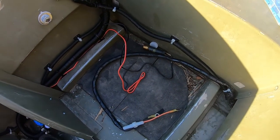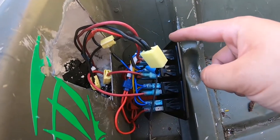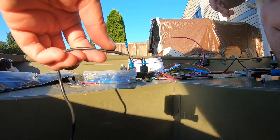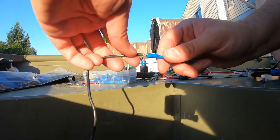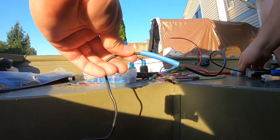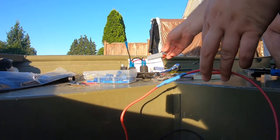We're gonna take the black and red wire from our new bilge pump and run it underneath the seat over to our new switch panel — it's gonna be our last switch on this side. We'll wire that up, then put this all back in. On the last video we did the three first switches which are the lights, and the fourth one's gonna be the bilge pump. Because the wires for the bilge pump are too short, we have to extend them. Here is the ground wire and here's the extension — I got a sleeve, because this will be in the well of the boat so I wanna make sure everything's watertight. That just goes in there — crimp that on. Pull — it's not coming out. There's our watertight sleeve; these are the heat shrink wrap. I extended that about two feet on my 12-foot John, enough for it to go under the seat.